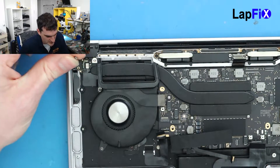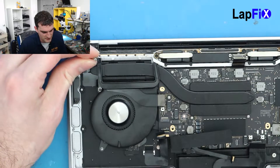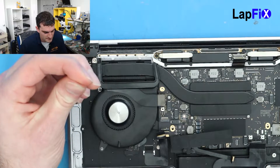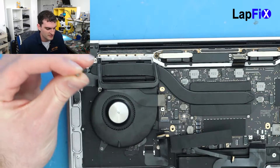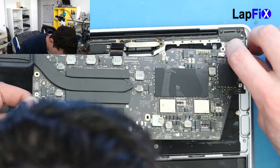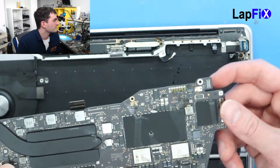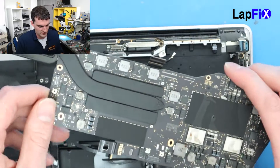This screw up here actually does need a special screwdriver — this is one we haven't really seen before on the new ones. It's the last one that attaches up to the heatsink up here. Worst case scenario you could use pliers to take it up. It's snagged a little bit — it goes underneath. You can see there's a little crevice here, and that cable actually goes underneath there and lifts over. This is the little board on the MacBook Pro.